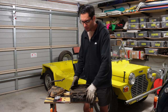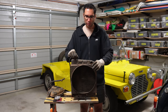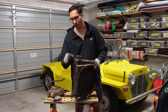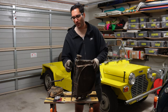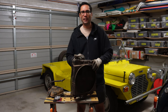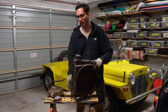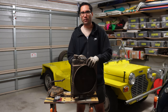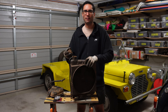On a Mini or Moke, depending on how you've got it set up, you generally do not completely fill this radiator right up to the top. On a modern car you may do that, and this hose here is connected from the top where the radiator cap goes and leads down to the ground. When coolant heats up it expands, takes up more space, and any excess liquid comes out of this tube and runs down. It only ejects coolant if the cooling system reaches a certain pressure — on Minis and Mokes that's usually around 13 or 15 psi, while some earlier Minis release at 7 psi.